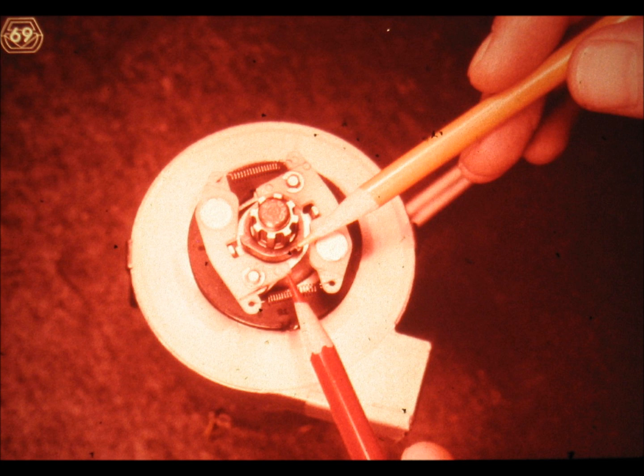Slide number 69. Let us now examine the motor clutch for a moment. The motor clutch is designed to allow time for the motor to build up speed when it is first turned on. Shaded pole motors have a very low starting torque. It is important not to load them down with anything until they have developed the proper torque. For this, we use the motor clutch.